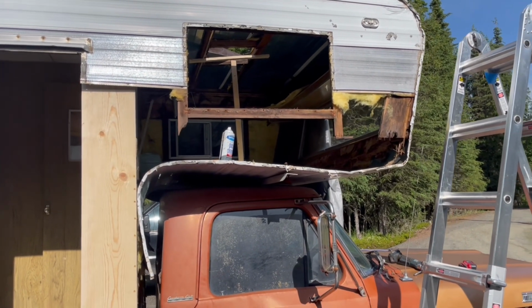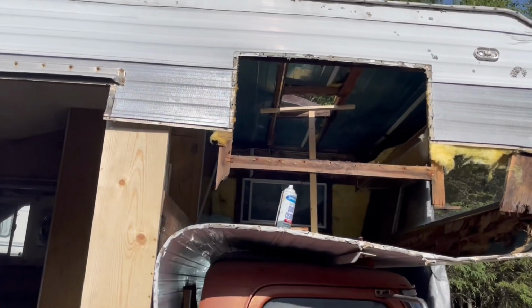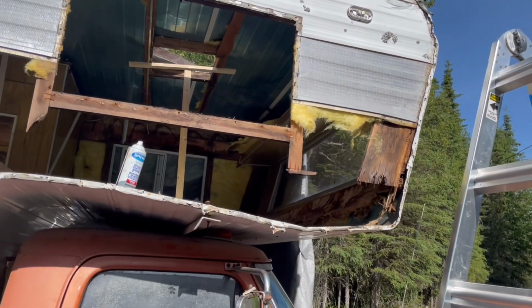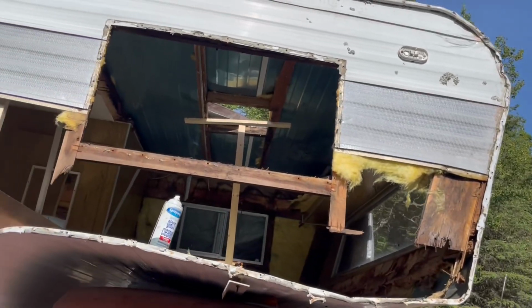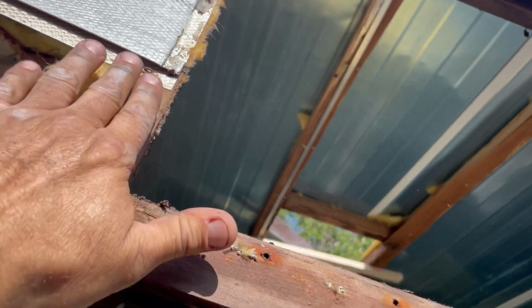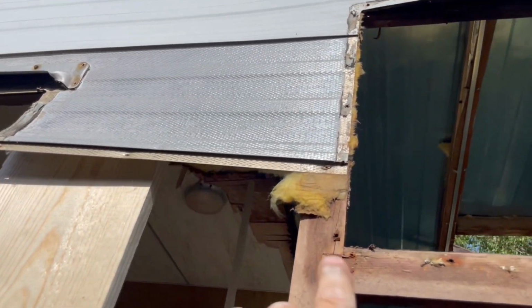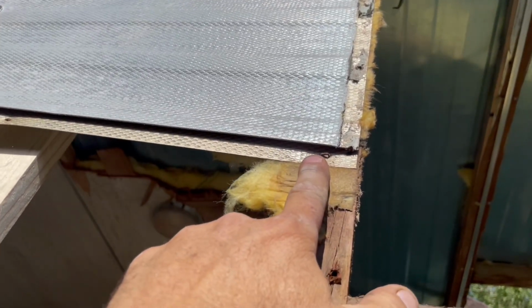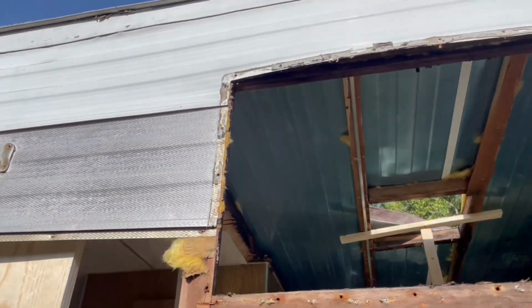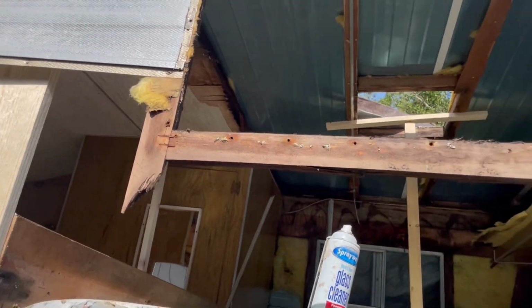I just realized that it's just going to be easier to take them off because they're stapled on. It didn't seem like it because the boards were all rotten, but in some places they are, like some of the corners. So when I'm done, I need to put a staple under the trim piece, and then the trim goes up in to hide it. I don't know if I showed that right there. And so I'll staple it, and then the piece goes up in it. And to get all this wood that's not rotten off, I need to take all those staples out.